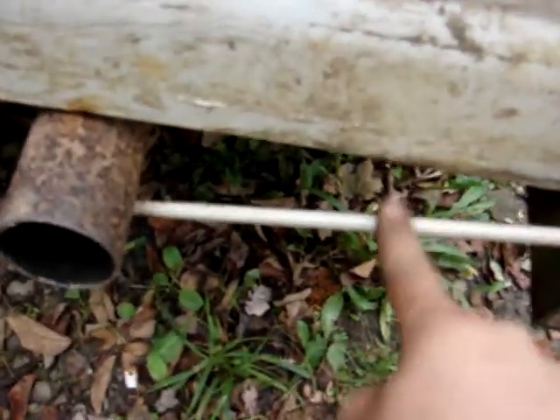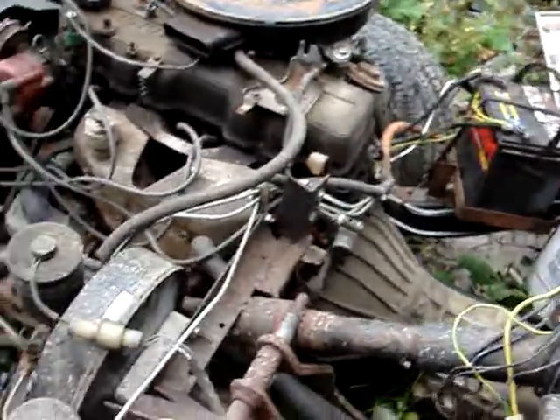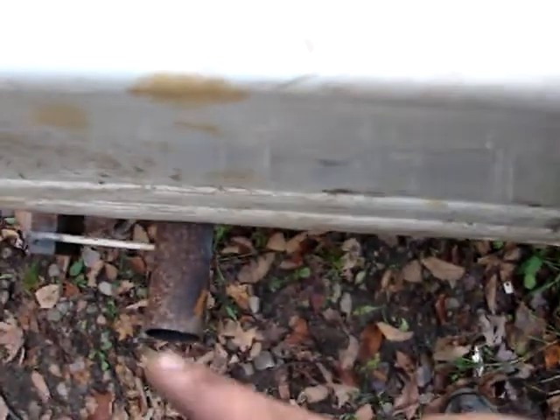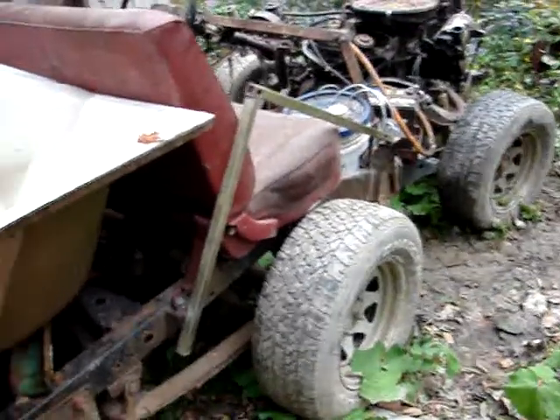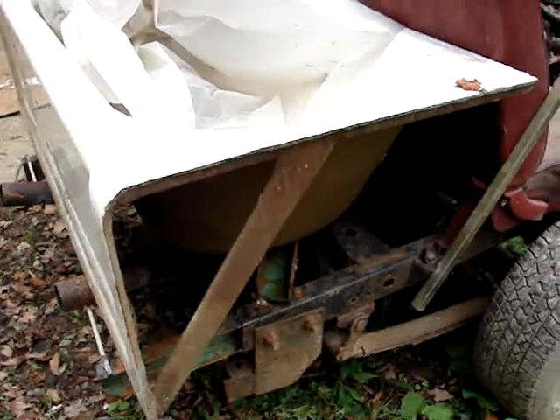I used some thin rod here so it'll give a little bit, because there's no flexible coupling in it and I don't want it to bust. I think that's what caused the manifold piece to bust off the Y-pipe — the old one was welded rigid and put stress on it when you rev the motor. They're not exactly the same length, so I think I'll nip this one off with my cutting wheel and call it a day. Get some plumbing figured out. Thanks for watching and tune in next time.